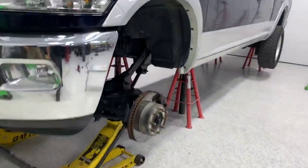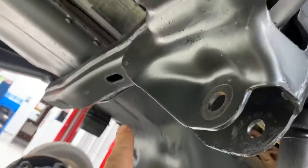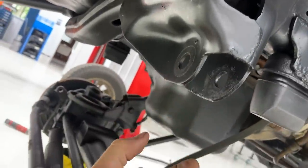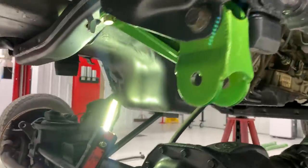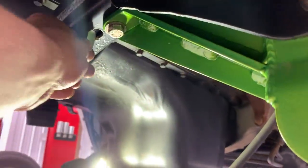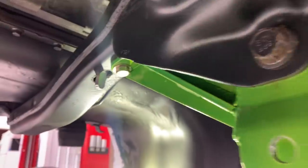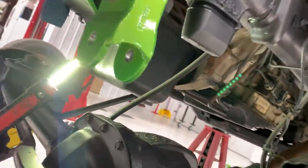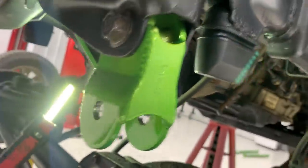The first thing the instructions want us to do is install the track bar relocation bracket, which drops everything down and lets you utilize your factory track bar. The factory bracket is here and the new one is going to bolt in farther over and just bring that hole down — that's the whole name of the game. With the bracket installed, you put one hole here and this little tab goes up at 90 degrees, giving you basically a welded nut to hold onto while you tighten it. The track bar will eventually go up in there.